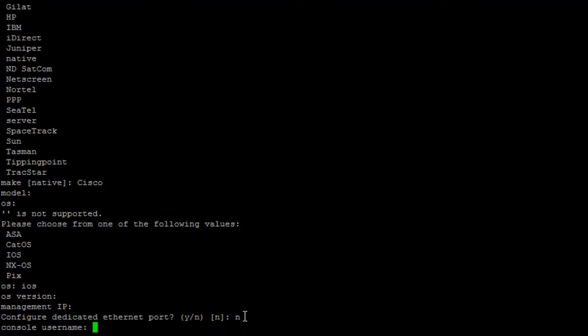And then once you have your network information for the device, that management IP address allows us to do file transfers to and from the Cisco device. That is crucial for a lot of our more advanced automation. When you want to, for instance, pull Cisco IOS, you don't want to be doing that over the console. It takes too long. So we'll need to use an Ethernet connection for that.